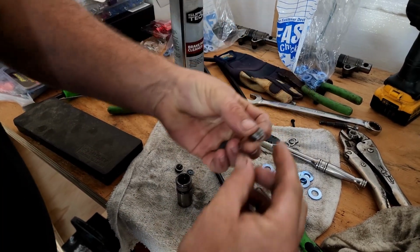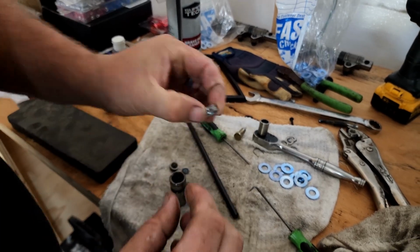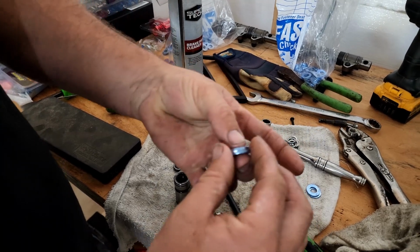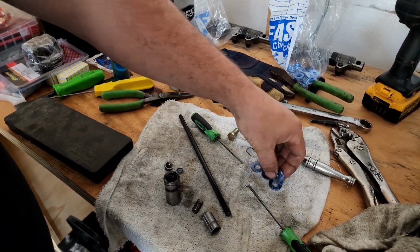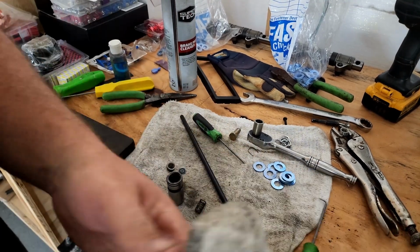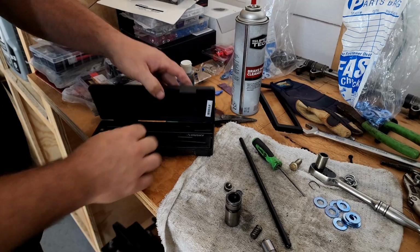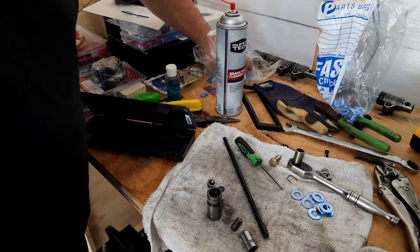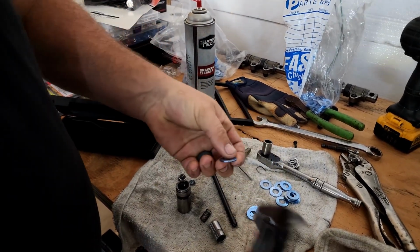And then I've got these washers that I've machined, and I actually have to do some more because I don't have any small enough. When you get these washers from your local hardware store, this is just out of the grade 8 bin. You buy them by the pound. They have different thicknesses. I don't know that they're supposed to, but I guess machining tolerances. And what I've been doing is I take my calipers and I've got bags of these and I grab a few of them and I just measure them.